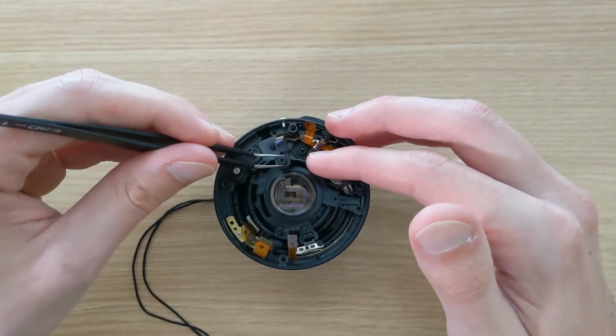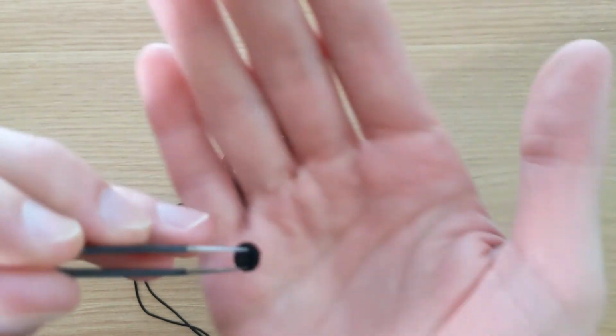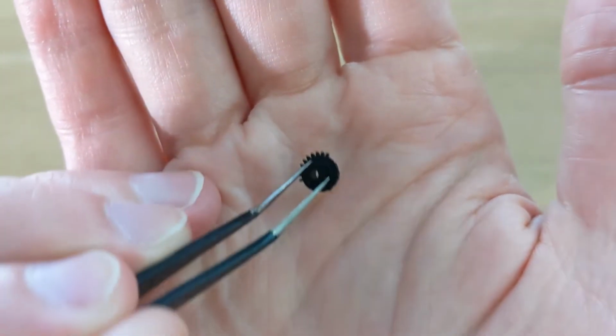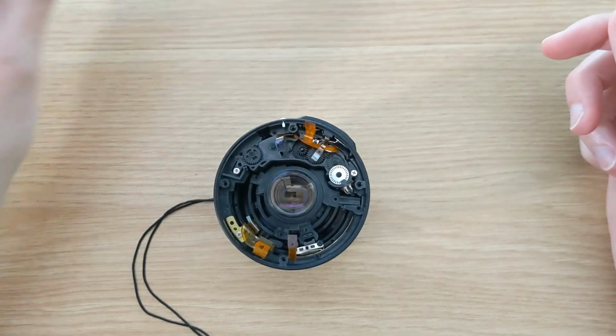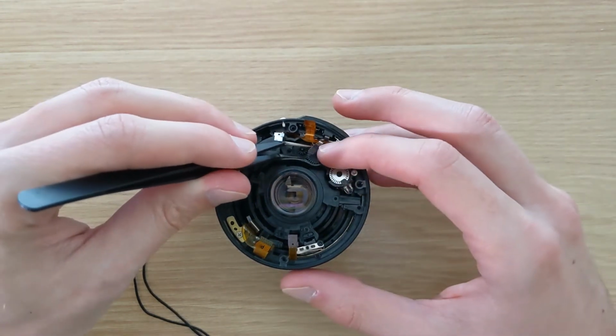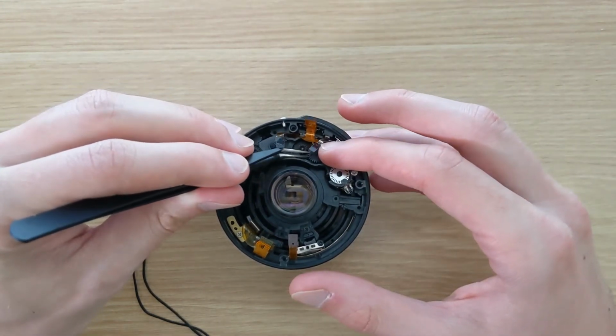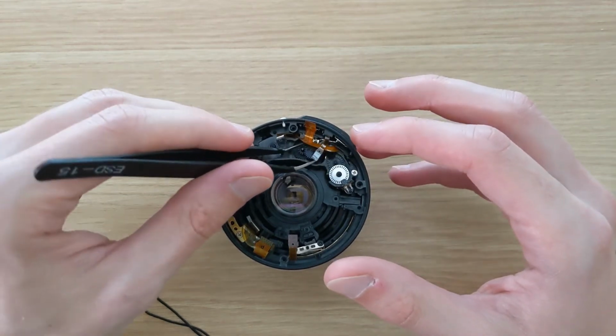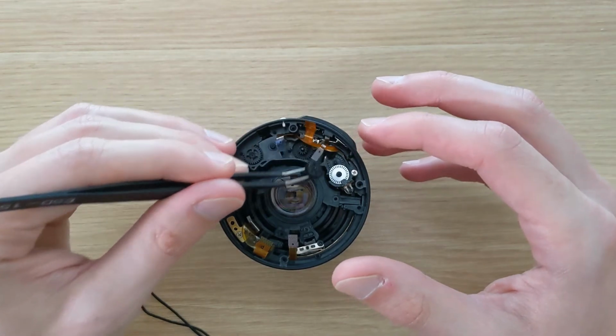And indeed, the second gear we look at is hardly a gear anymore. More than half of the teeth are stripped off of it, and so that gear no longer works properly. It will start spinning freely when it hits that part of the gear without the teeth. And that's probably the sound we heard when the camera tried to focus.